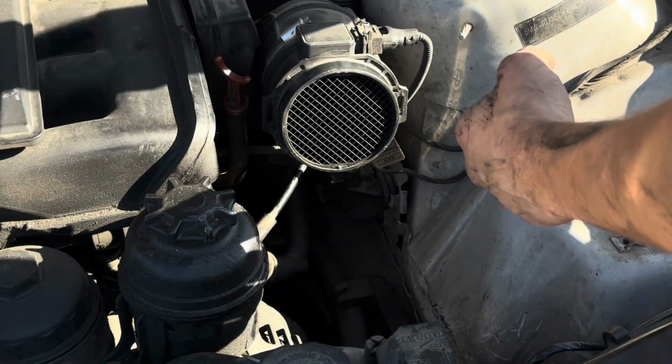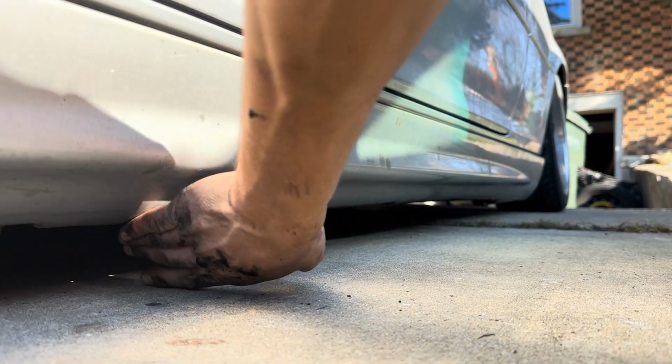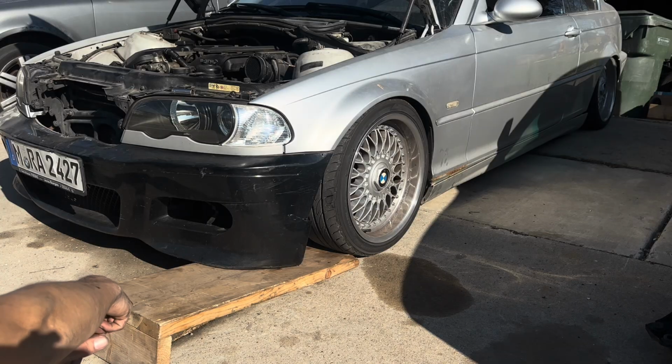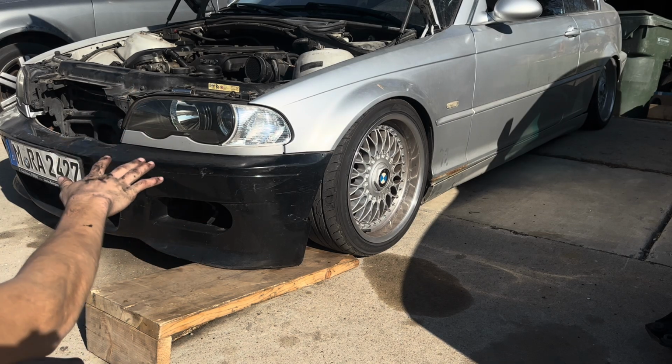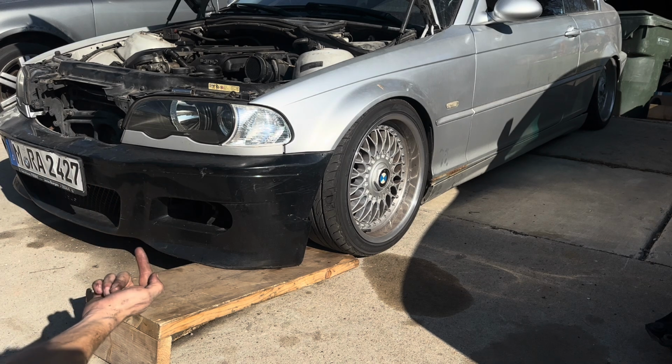Well, I definitely got it off. Alright, got the nut off. Unfortunately, I'm not stock height, so I could barely fit 3 fingers under my car. Wood ramp, I jack up the car, set it down on a jack stand, and then, while the car's on the jack stand, we'll jack up the motor.